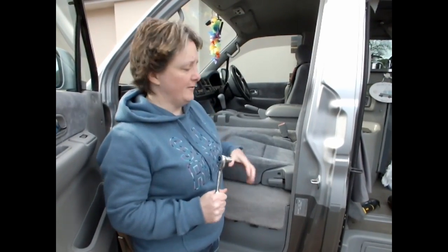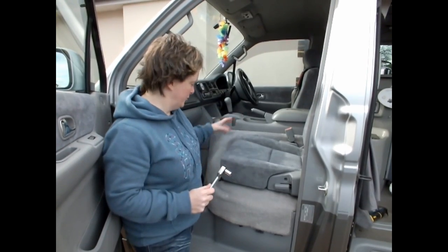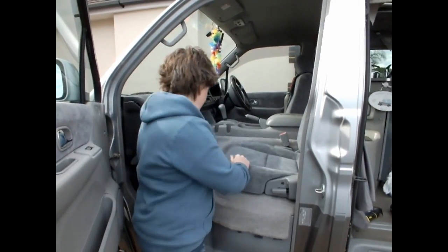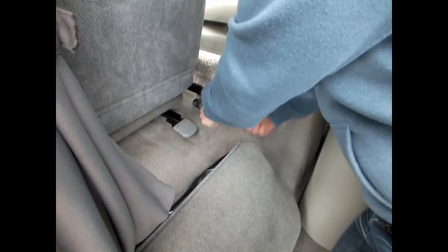The first thing we need to do is undo the five bolts that are holding part of the seat in. You need a 14mm socket or spanner, and I'll show you where the five bolts are. We've got two at the front here, then one down the other side — I'll show you the other two in a moment but let's grab these off first. We've got another one at the back here, so I'm just going to ease that one off. They can be a little bit tight.